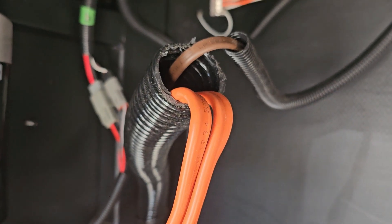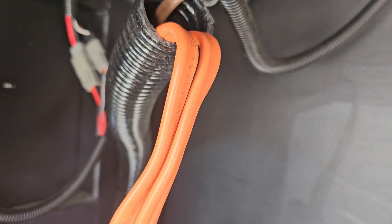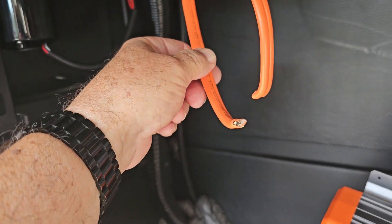So I would rather have the shore power energizing the relay than the inverter. Here's what I did. First, it is absolutely necessary to remove all power — I unplugged shore power, turned the switch off from the solar panels, and disconnected the batteries. I also turned both breakers marked inverter prep off. And once I located the orange loop — mine came from the bottom of the front storage bay through a large black plastic conduit, with the orange loop hidden up in the top rails — I pulled it out, making it accessible. And I want to warn you: make sure there is absolutely no power to the unit before you cut this loop.